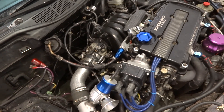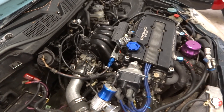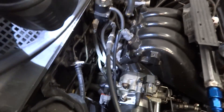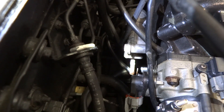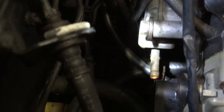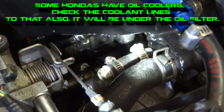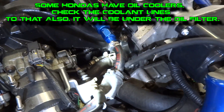Now I'm going to use another engine. This has an idle air control valve — it's an Acura Integra GSR. Pretty much the coolant lines actually run through the idle air control valve on this model. As you can see right there, this is the idle air control valve right here behind the intake manifold, and you can see that nipple — that will leak sometimes also. Another leak would be on the back of the intake manifold — you can see right there where the water lines actually run through it. Those tend to leak too.